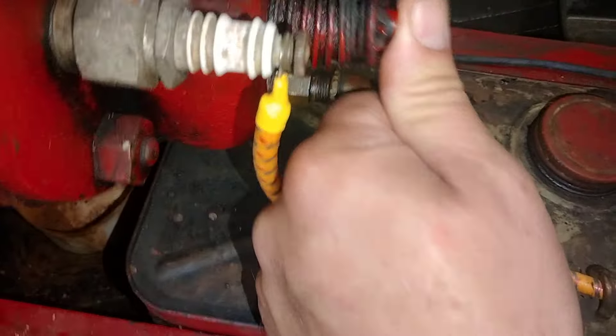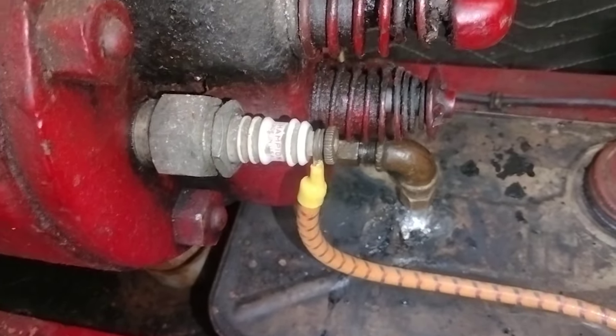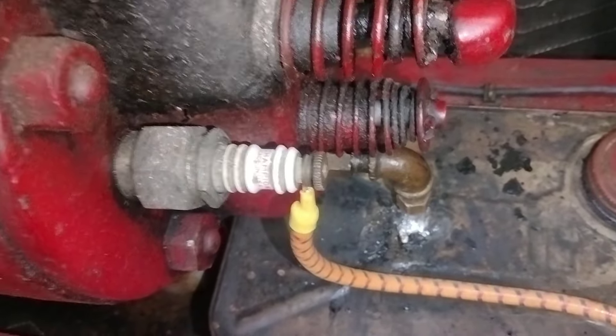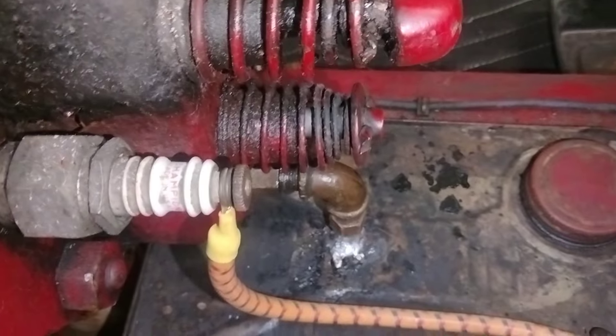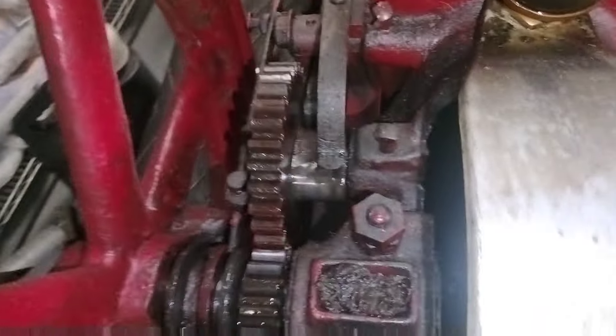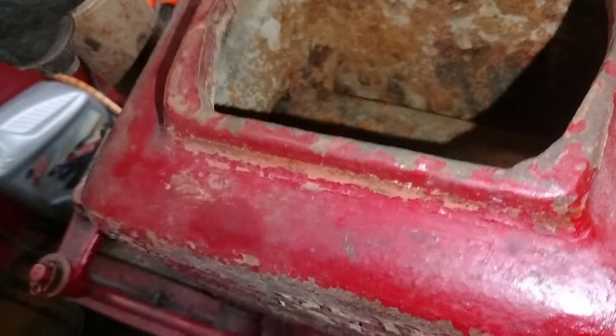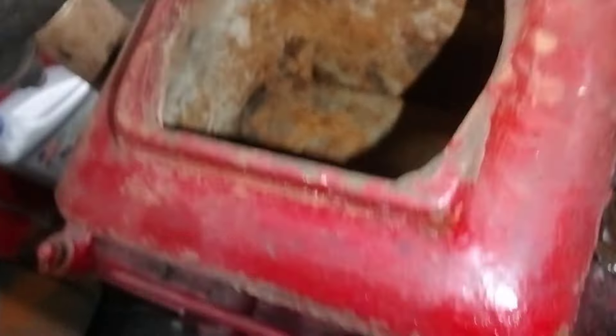Every once in a while the idea of a buzz coil comes up — very old technology, but actually super effective for these machines. There's a battery-operated box with a relay inside. It creates a continuous spark, kind of like a multiple spark discharge — long before that was invented by others such as MSD. They were doing that with these buzz coils, which you find on Model T's and other early engines.